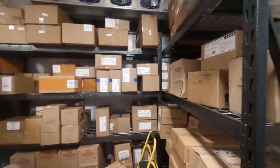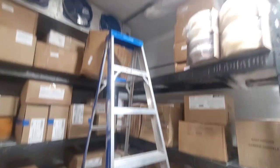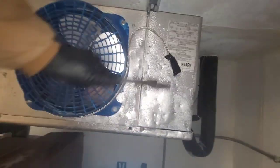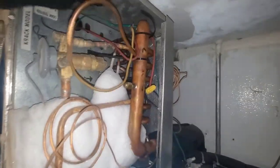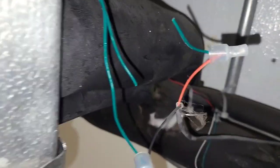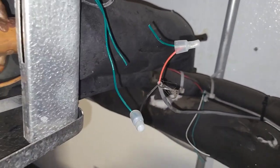It's a little better, but it is cold in here. The worst thing to ever have to do is work on a freezer that isn't broken. After moving everything out of the way and setting up the ladder safely, I head up to where I think the sensor could be and take off the screw that holds the cover. Once inside, you see all these wires. There's a green wire — if you look very carefully — that has a sensor going right into the evaporator. But we can't just change it and think that's it; we've got to test and verify. I cut the circuit open and go look at the computer to see if it reads above 200, negative, or shows an error.